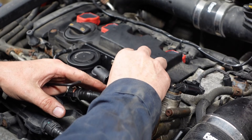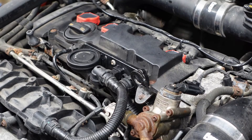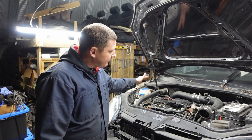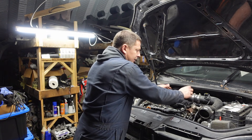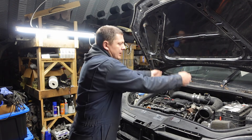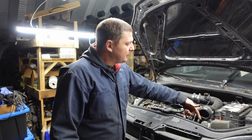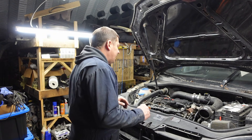Hook the hoses back up — they just need to slide on and click into place. Super easy job. All I'm going to do now is start the motor up. Obviously I don't have the engine cover on because of this aftermarket intake, but if you have the proper engine cover you'd unplug your MAF sensor, undo the two spring clips, lift it off its little posts, and take that cover right off. If you still have your air intake, undo the two screws that hold it as well.